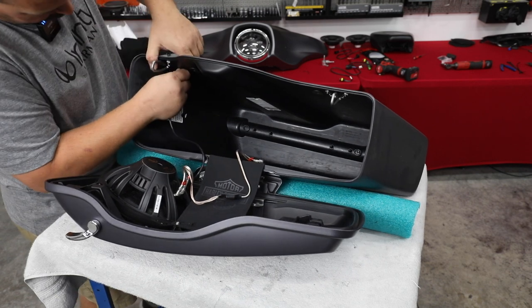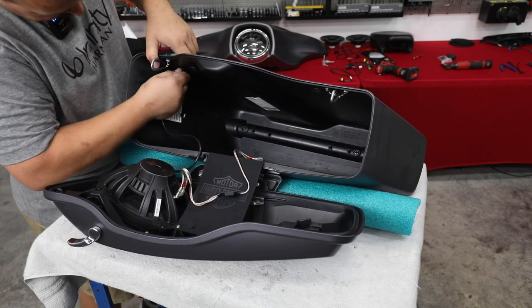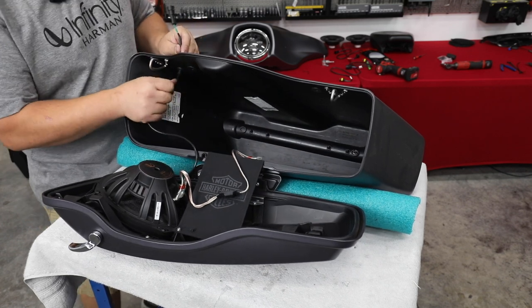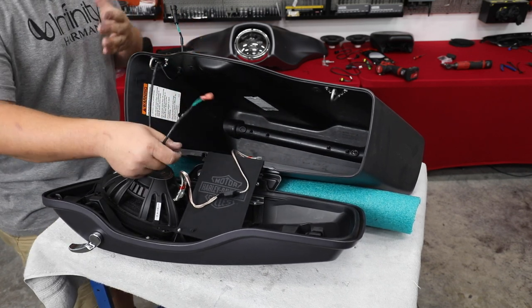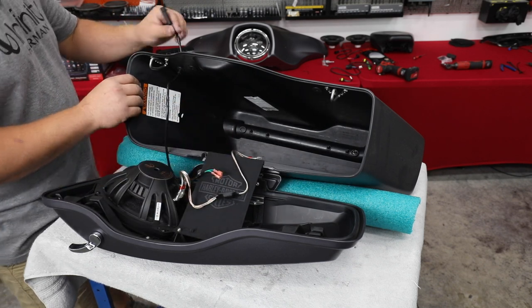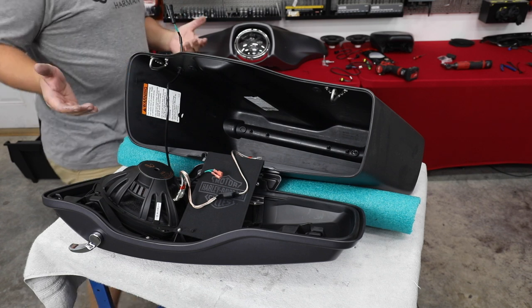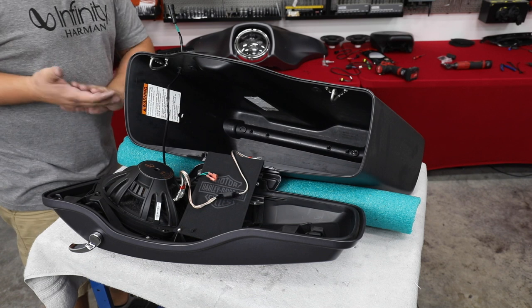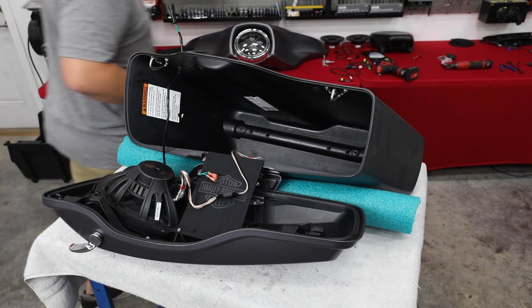Like I say, it's a 3/4 hole that we just did. There we go, we've got our grommet installed. We're gonna pull quite a bit of wiring into the bag until we get it secured. And then we'll pull what excess we have back to the outside. I'm gonna get some rubbing alcohol. I'm actually gonna clean some areas. We're gonna put some little stick pads and we'll get our wiring connections made next.